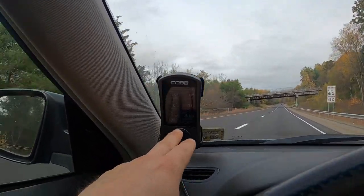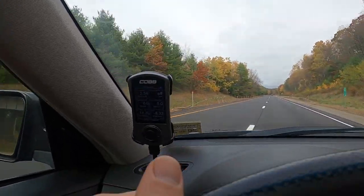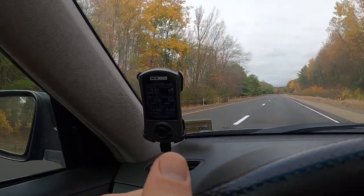I could see on the Accessport the ECU going to no more feedback knock, no more fine knock learn - ECU totally happy. It would also pull timing sometimes when I got off the throttle, and I was also seeing it run lean, falling into the 16s. So Matt changed the mapping values and graphs, bringing some up and some down, so now timing isn't as advanced while cruising on the highway, leaving a little room for going up a grade or getting my foot into it to adjust speed.